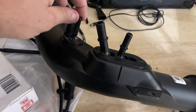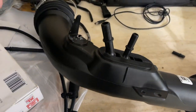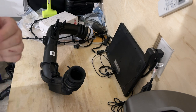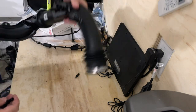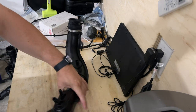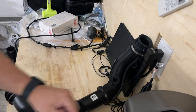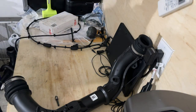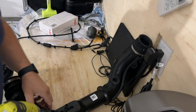I'm going to try this AWE fitting first. Since this fitting was so easy for me to snap off — it wasn't much harder than that before it broke — I want to find a good permanent fix. The original piece has small, fine threads, and feels like aluminum since it's very light. The threads aren't much bigger than the tube itself. I'm going to start with a small chamfer bit on this extra intake tube and try to get a viable fix for someone else who might do this.